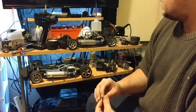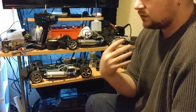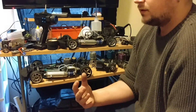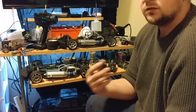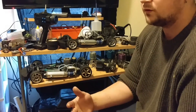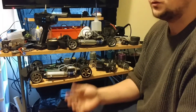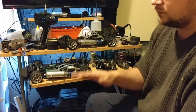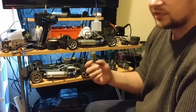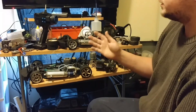With vehicles that have catalytic converters, inside a catalytic converter you have a catalyst. Once it gets hot, the extra fuel in the exhaust comes through, and the extreme heat of the catalytic converter burns off the extra fuel so you don't pollute into the atmosphere. That's how catalytic converters came about in the 1970s. When they first came out they didn't put any kind of heat shield, and if you parked over dry grass or brush, it would actually catch fire because they get so hot.